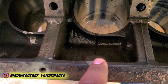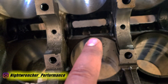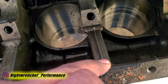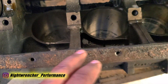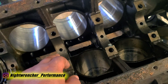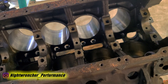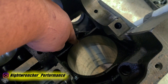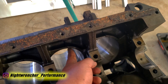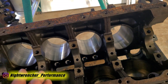This is more or less what you're looking for — I knocked off some of this casting flash here with the die grinder. You can see casting flash in several spots and I've already knocked some of it down. There's also casting flash along the main web which I've knocked down right here. This only takes a couple minutes but it adds up quickly. The precaution to keep in mind: do not hit any of the registers and do not hit the main journals themselves with your grinder. If you think you're getting too close, stop and skip over to something else. Also, do not cut into the bores themselves — you're going to have to go around them. A lot of times the piston doesn't even go that low, and if you're not paying attention you're going to have a bad day.